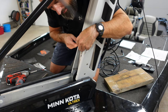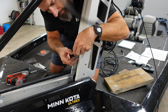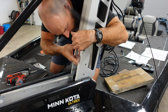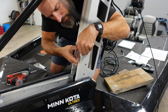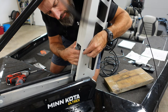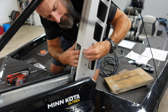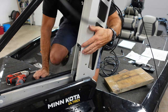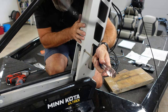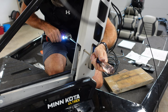Take that pin, put it through that hole, then put a spacer on there. Lift your gas spring up and start putting it in. Then take the other spacer, get it started in there, and push it in. Then get your other screw started — don't throw a drill on there until you know you've got the threads started; you don't want to strip this out. Try it a little with the screwdriver first. Now it should be a lot easier to go up and down.